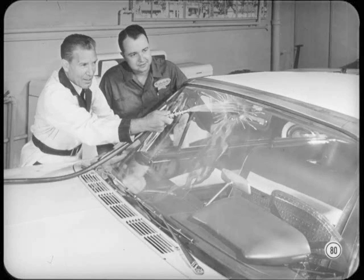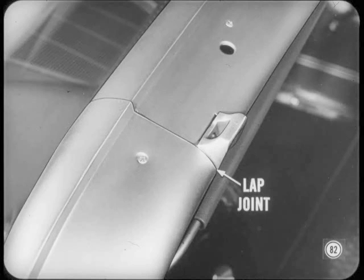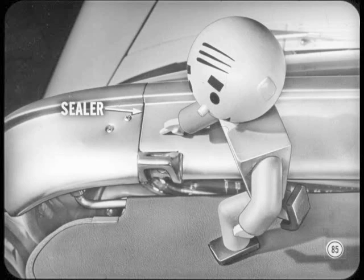You can use a hose to test for a leak under a windshield header — a leak will show up along the windshield molding on the inside of the car. Wiping sealer under the front edge of the header is your fastest fix. A permanent correction is to remove the moldings and cement a strip of 3/8-by-1/2-inch closed-cell foamed plastic along the top of the windshield weatherstrip. If there's a bad gap at the lap joints, remove the side moldings and reposition them — the inner end of the side molding should butt against the top catch. You may have to grind off the weld flange at the upper end of the windshield pillar to get a good side molding fit. To improve the lap joint fit, drill a hole about a half inch from the inner end of the side molding and install a sheet metal screw. A gap at the fillet can be reduced by reforming the end of the side molding, then wipe sealer into the joint.